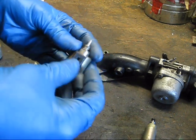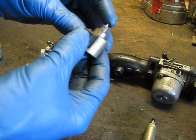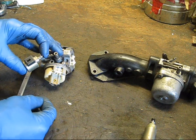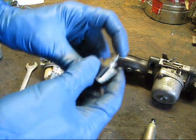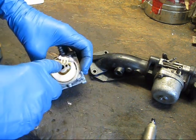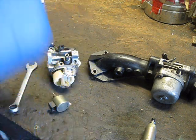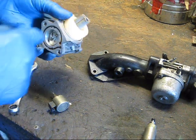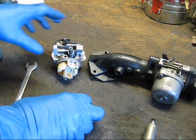These solenoids are wired into a key-on ignition source. So when the key is on, the solenoid is energized and the plunger is retracted, which allows fuel to flow freely through the carburetor like it would in any normal carburetor. When you turn the key off, the plunger extends, blocking the flow of fuel through the emulsion tube and into the carburetor. That way, when you turn off the key and your engine is coasting down, it's not drawing fuel in from the carburetor, which can then get pumped out into the exhaust and cause a backfire.